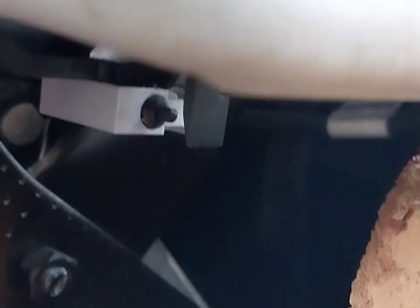Once you turn the switch on at the pump, what the micro switch actually breaks is the ground. When you push down it lets the air out, and pulling up raises the seat and makes contact with ground. Electronics people are probably saying you shouldn't put power through the micro switch — that's too much power — but I'm not an expert. Basically, power goes to the compressor and the micro switch breaks the ground.